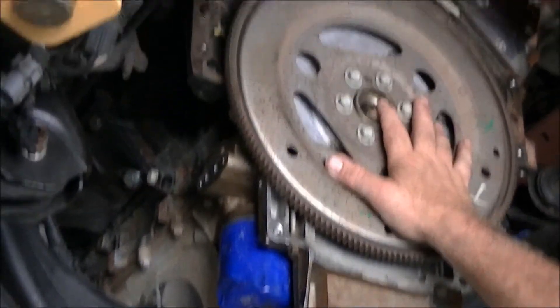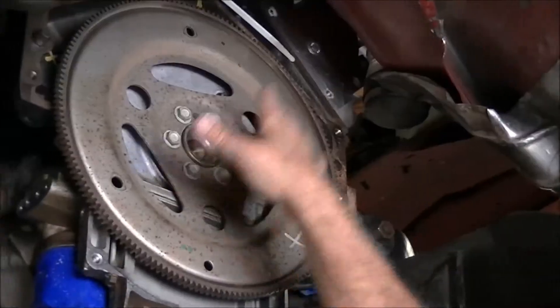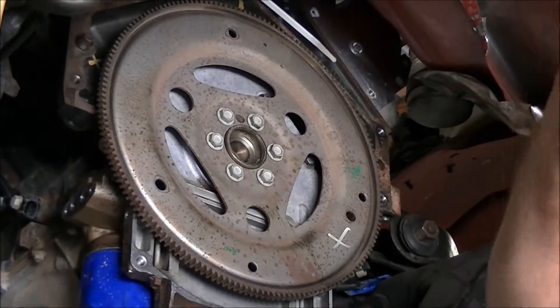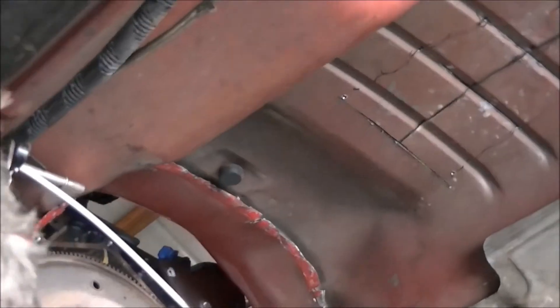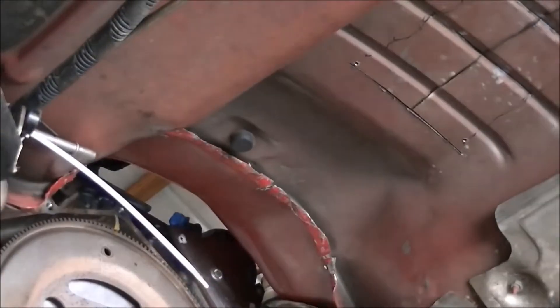and the fact that I want to have a nearly zero driveline angle for a lowered style truck — or at least zero to negative two degrees, two inches or three inches — I'm going to have to push up the tunnel just a tiny amount. And I'm going to show you how I do this. This is a very simple way I do it,